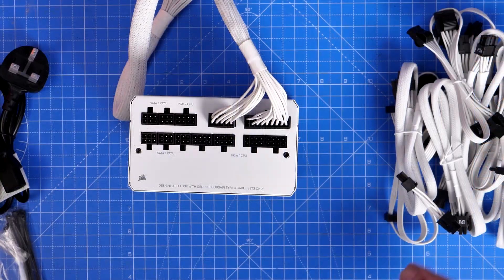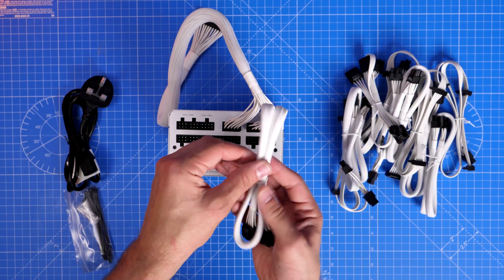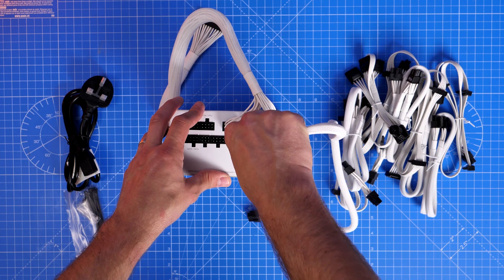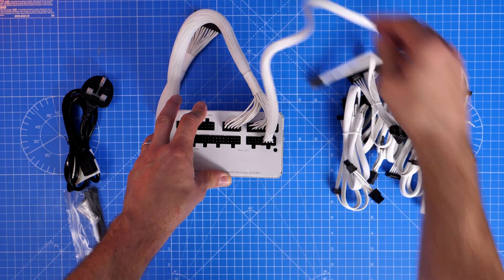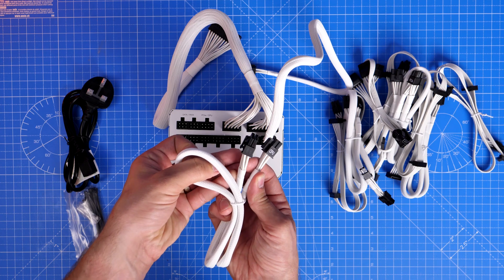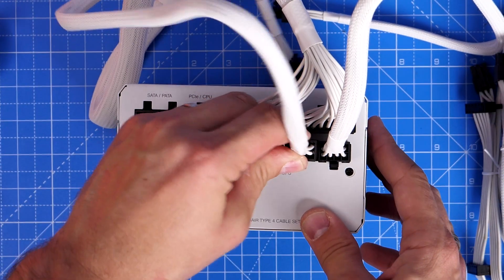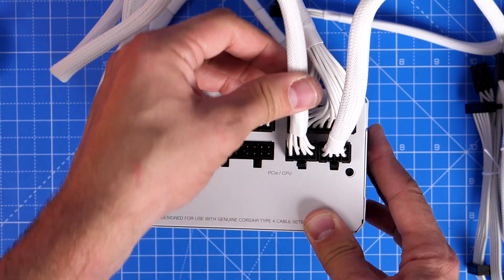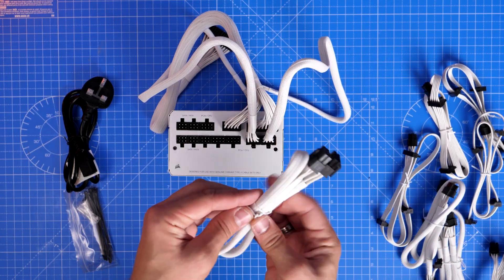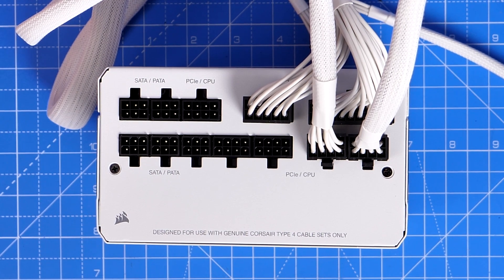You can manipulate this cable around — it's a little bit fiddly and not that neat, so you might want to consider cable extensions or fancier cables, but the standard cables are pretty flexible once you've got the hang of it. You'll also find some important CPU cables; these plug into the top of the motherboard to make sure it has enough power for the CPU. Again, you'll find markings on the cables saying CPU and also on the power supply unit. You should find three cables in the bag with CPU labeling.